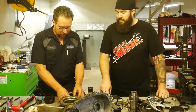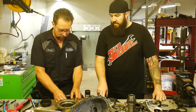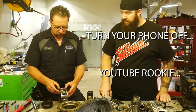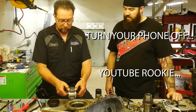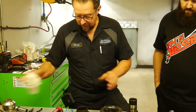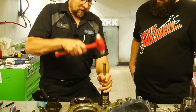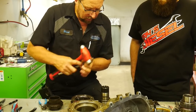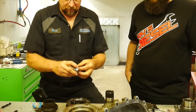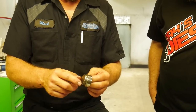Sure, for any of them, what we want to do as soon as we get it apart is we check the planetary gears. Each gear on here, we check for any movement. We also check to make sure the plastic thrusts down in here are not broken. That can be another issue. We're definitely going to knock our pocket bearing out of the input gear, get that out, always replace that. We've had a few that if you chance it and say, well, the bearing looks good, I'm going to run it, they'll get a hairline crack in here and you won't see it.